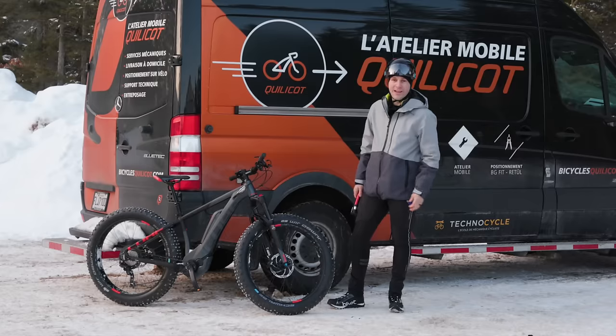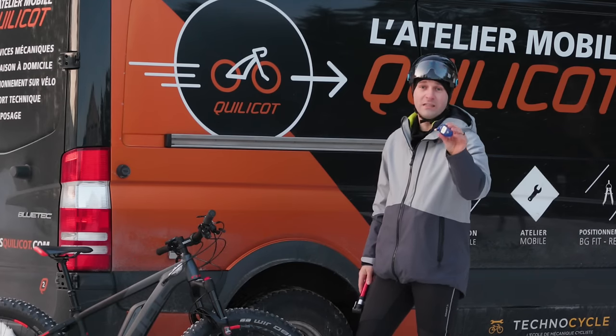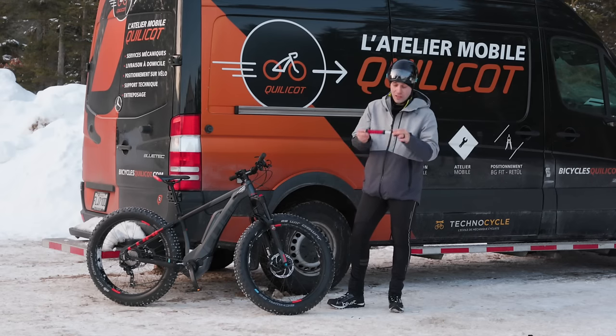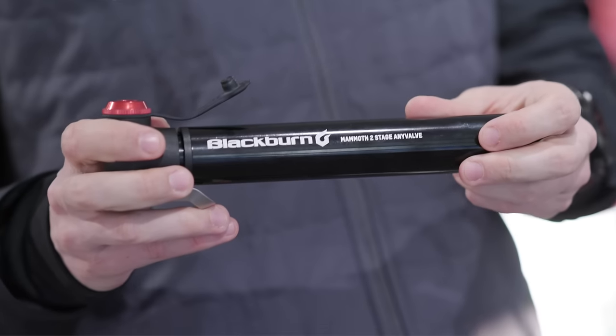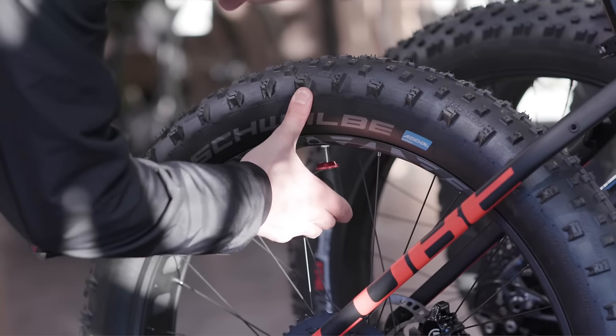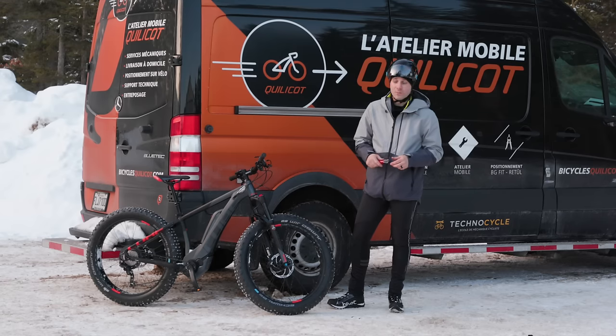Friends, a couple gadgets for you to have out there on the trail. Digital tire pressure gauge, so you can see the tenths of PSIs. We're working with small pressures, important to have so you know where you are, so you can really tune in your tires for the trail conditions. Another thing, hand pump pushes high volume. Very important, you wanna make sure that you're not pumping all day, you wanna be there checking for something that'll pump between 0 and 40 PSI for you in high volumes.